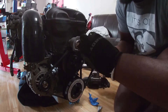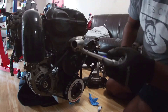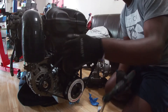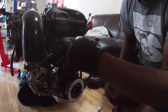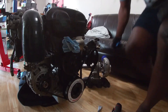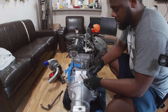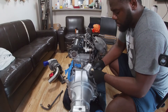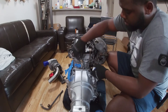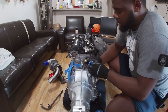Then you want to get your neck. It's aluminum, so be gentle. We crank the factory torque spec on the back and the front. I'm going to plug it with this rag just so we can keep everything out of there until we get it in the car, and the same thing with the back. In the rear, we also have our sensor if we're on a later model. For the earlier NAs, the sensor is in the front, I believe, and it threads right into here. But I'm going to put some Teflon tape on there first to make sure that we have a good seal for the threads.